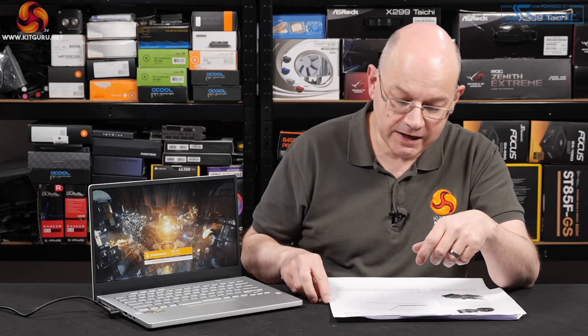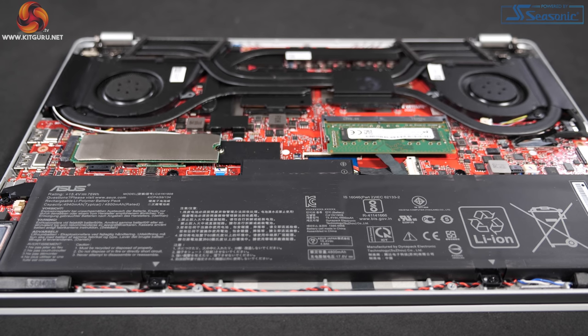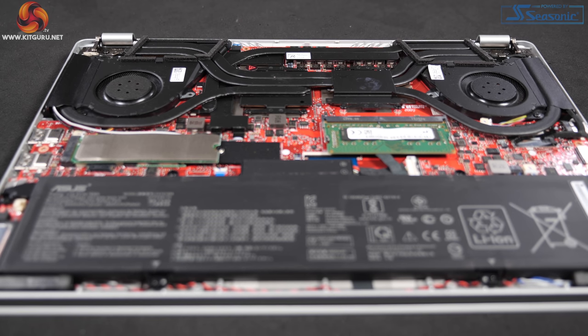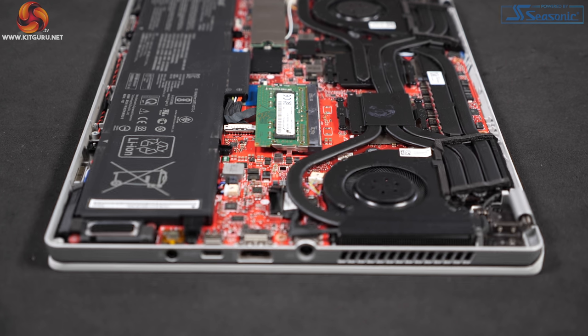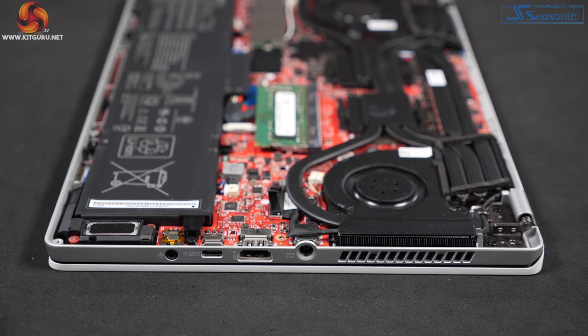I do know the G14 is very good, and when we pulled off the back panel and looked at the cooling system inside I could see why ASUS was so pleased with themselves. For such a tiny laptop the cooling is extensive: 5 heat pipes, two clever fans with variable-length blades — long/short alternating around the fan to reduce turbulence — plus their dust bypass device. The system works really well and the slender chassis is just so impressive.